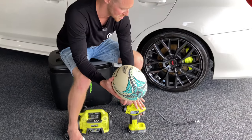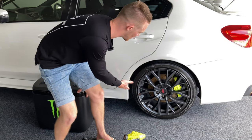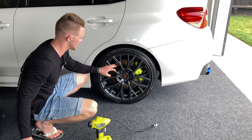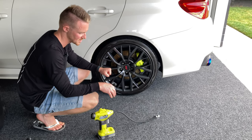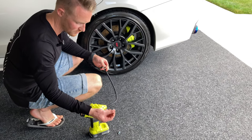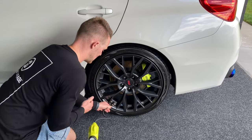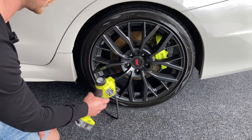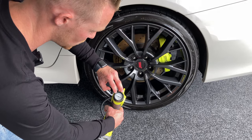The main way I use this machine is when I'm doing weekly maintenance checks on the car, inflating the tyres. I know this back one here is a little bit deflated — it's generally inflated to 220 kPa and I know it's at about 198-199 right now, so I just did a reading on this. We'll take those attachments off, so it just attaches onto the wheel — pop it on, click it down, it's in place, and I like this machine because I do have ample room to move around. The gauge on the end is showing about 26 psi at the moment.